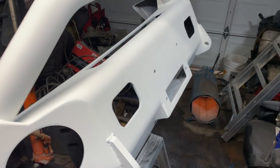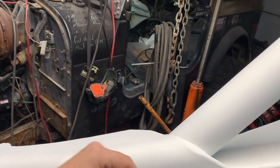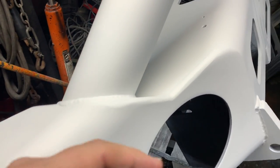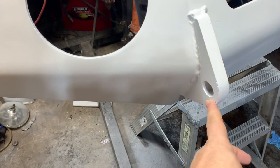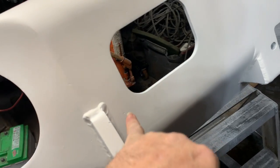This one scratch is still here and these ones are still here too. So we're gonna give it another quick sanding. Then we can go through any of the low spots — where you can see the dark since it's white paint, I want white primer. There are some dark spots; I've got to get it off the hoist so I can paint in there. I'll take the sander and sand these down to primer those again. I'm gonna hit this one and the drips over there.